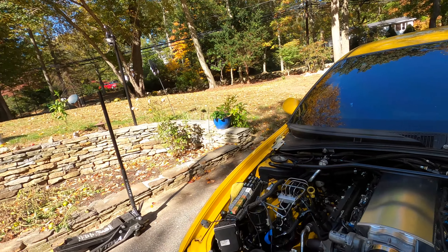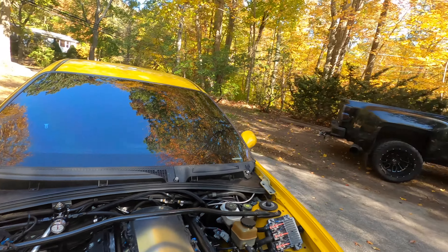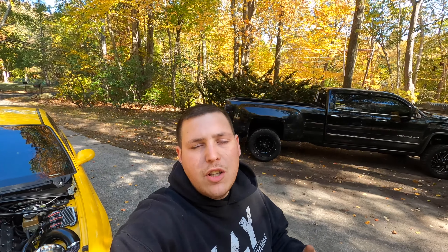In the video it almost seemed like I hit rev limiter before the boot blew off. Well, rev limiter was set at 6,000 RPM but it started breaking up around 5,300. We're not sure exactly what happened — the tuner said it seems like it went lean pretty abruptly, immediately. We're not sure if we're losing fuel pressure for some reason. With these ECMs you can't log fuel pressure through the factory computer the way it's set up. We have a fuel pressure gauge but it's on the regulator, so you can't see it when you're driving. We're going to try to do something about that — maybe order an in-car fuel pressure gauge.